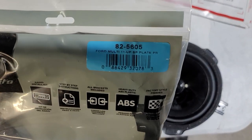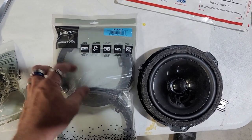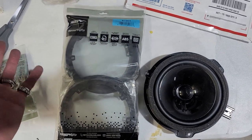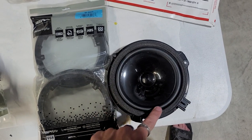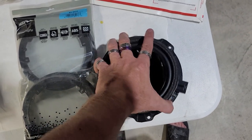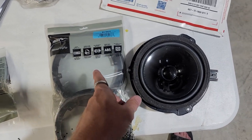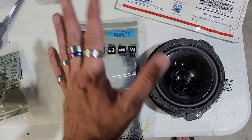These are the speaker adapter plates you're going to use — part number 825605, the Ford multi-plate. They also make generic versions that we'll put down in the description below, so there are multiple people that make these and I've used all of them; they all work pretty good. We're going to put these in and then use a new six-and-a-half to go into this. We'll have to drill a hole so the speaker wire can come through. The factory speaker has a pretty beefy magnet on it, so we're going to put some good speakers in here to reproduce some good bass. We're also going to dynamat everything to make it look nice and sound nice with no rattling.